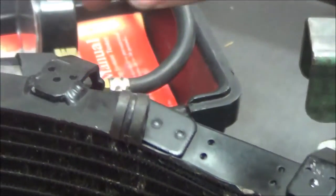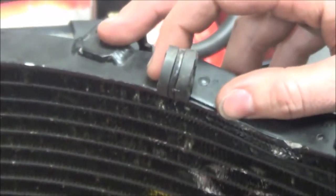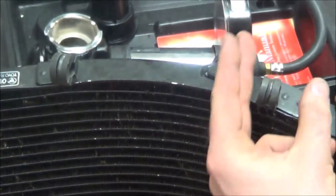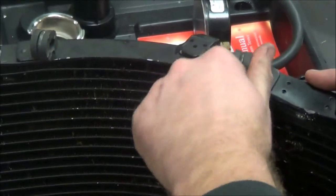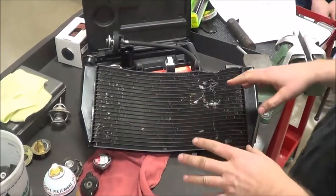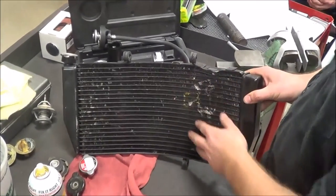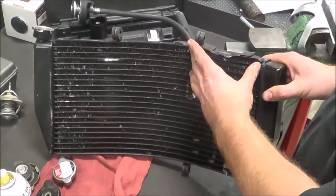What actually condemned this radiator is where the coolant line was pierced right here — you can see it's actually severed. So this radiator is junk; nothing you can do. Also, these fins and brackets are very thin aluminum — if a customer has a crashed bike and doesn't want to spend $400-500 on a new radiator, don't start bending these brackets or you'll break them off. I'd make an additional mounting bracket or have the customer buy a new radiator. Twisted, bent-looking radiators can still work fine — the big question is can it hold fluid and how much cooling capacity are we willing to lose.